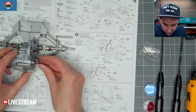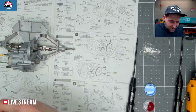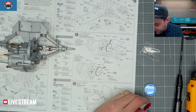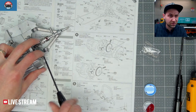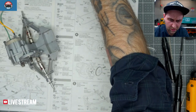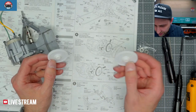All right, it goes on backwards, obviously. Low, it's too fast as it is. Hey, there's Alberto. Hi, my friend. I really hope I don't need those torsion bars, because they're definitely not going to be used again. All right, we'll loosely place the pinion on for now. Low, so the speed is not too much for you. You guys know how I am with speed. Not good. And then obviously the larger of the two spur gears will go with the smaller of the two pinions. So we'll go 70 tooth.